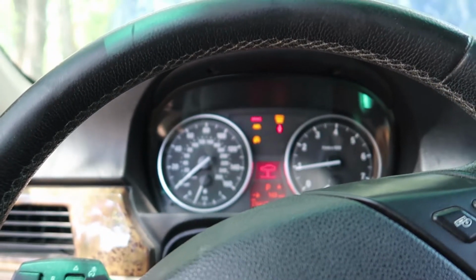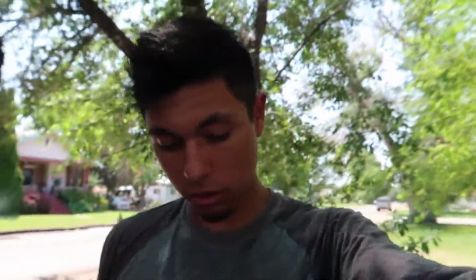Yeah, that's not coming off. I'm gonna look around, see if I can find another sensor so I can go pick that up, but other than that, I don't think that I'm going to fix this one. It was reading 2 ohms, and I think it's supposed to be reading 0.6, so I think it's reading a little high, and the actual connector was reading, I think, less, so something was wrong there.